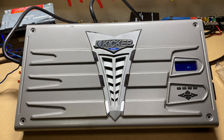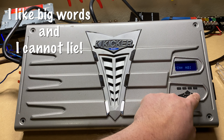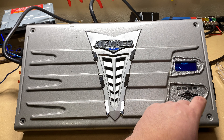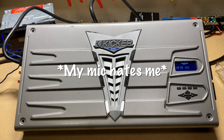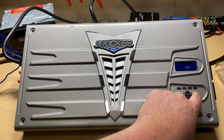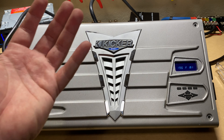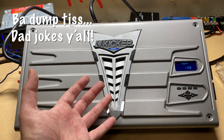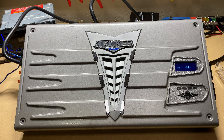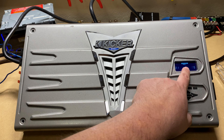One of the cool features is the Sick Bay. You can have pink noise straight from the amp - that's a very cool feature. You can see the history of this amp, you can see the runtime - this one's had 197.9 hours, so about 198 hours. You can see the max temperature this amp has been at: 196 degrees Fahrenheit, so it's gotten pretty warm and yet it's still kicking. You can see the temperature now, and the max voltage it's ever seen was 15.2 volts.